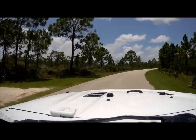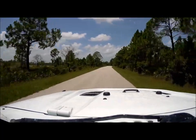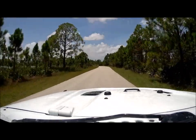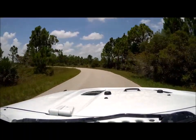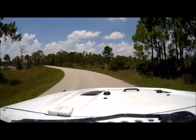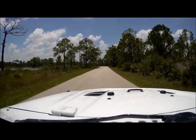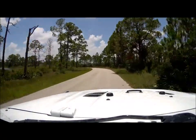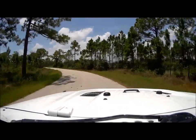And when I first got this vehicle, I had a hell of a time where I would be on the highway sometimes, and after I wheeled for a while, all of a sudden I would get all kinds of lights flashing on the dash. My speedometer would go crazy, lights would flash, things just weren't right. It would stop, it would come and go. Well, it ends up that that connector, even though it was tight, was full of powdery dust.